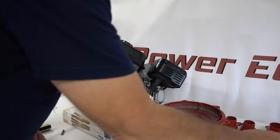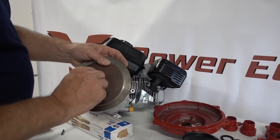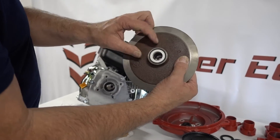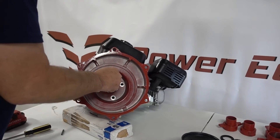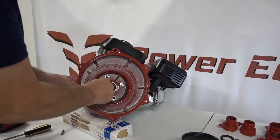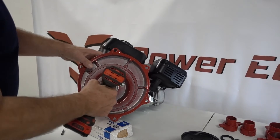The kit itself came with a small keyway, and we're going to put that in the impeller. The problem is the original keyway won't pass past the seal, which is why we have to take it out. We put the new keyway into the impeller just like that — the keyway is now set inside so it doesn't have to pass through the seal. Now we're going to install the housing: put it up, wind up the bolts, and get each one started by hand. For this Predator engine, all the bolts needed were in the kit — no additional bolts needed. Get all bolts started by hand first to avoid cross-threading.